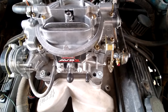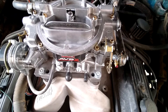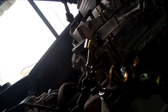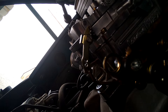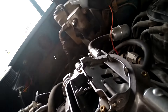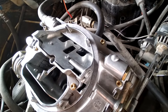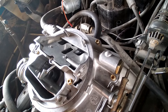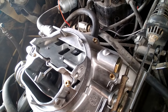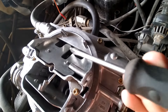It kind of loads up with fuel. I'm going to try turning them down but I may have to try another old school trick. I've got the accelerator pump in the bottom hole just because it does load up with fuel and it's rich straight off the hit, so I try to compensate by leaning out the accelerator pump. On my secondary flap I've actually got it tightened to two and a half turns because when it would transition from the main jets to the secondaries I was getting a cough and a hesitation. I pretty much worked that out by tightening that flap — these flaps make everything a little more tunable.